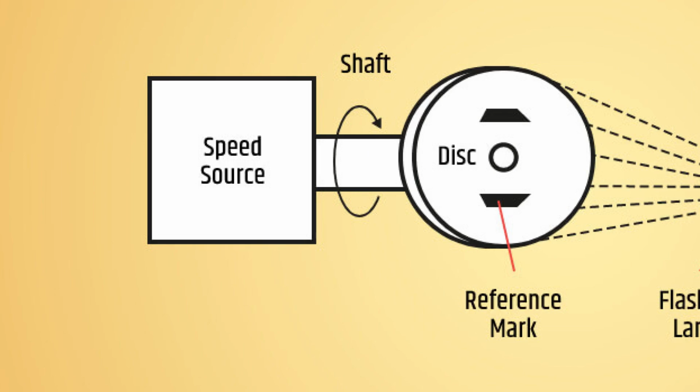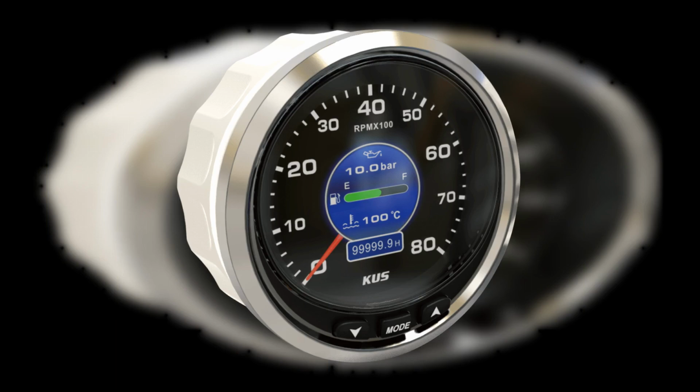Digital tachometer. It is an electronic indicator, screen, scoreboard, showing the number of engine revolutions at a given time. It is believed that such a representation is most convenient when working with electronic control units or when tuning, fine-tuning, the motor. The device also includes a processor, a converter of analog signals into digital signals, an idle valve sensor and another converter, which is needed to transform electrical signals into light signals, an optocoupler.